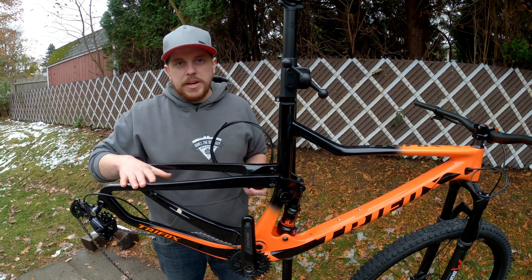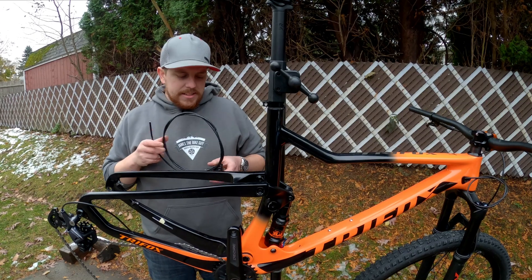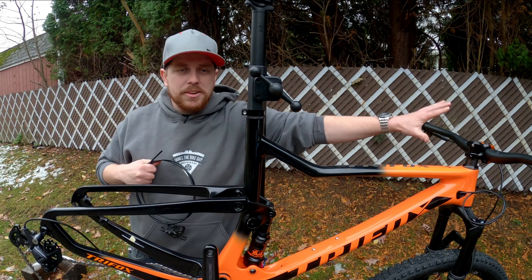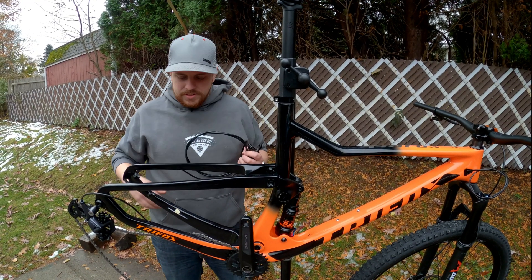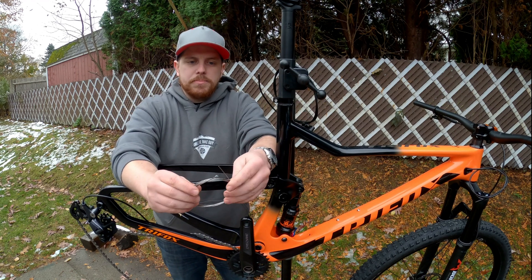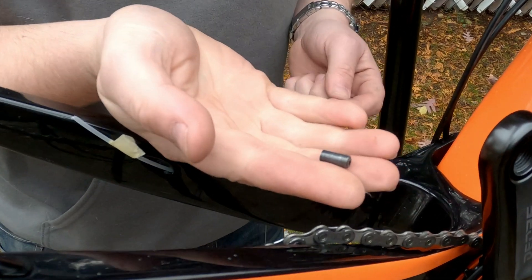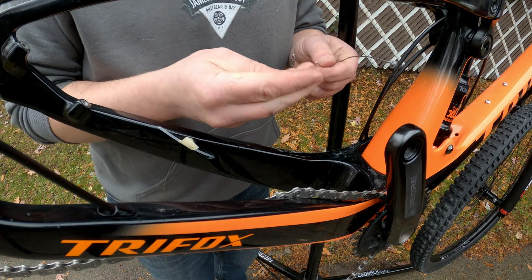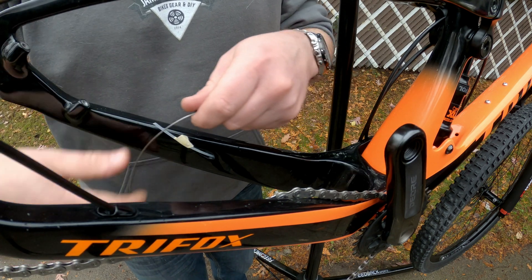To get a new hose installed on a frame, I find it almost always easiest to go from the back of the bike and send it up towards the front. That's because it's generally easier to cut and adjust the length of hose up at the handlebars rather than trying to get that set before you run the hose back. Because this frame has a plastic tube inside to help guide us through, we're going to start by taking apart our shift cable. With the shift cable unraveled, you can take your little ferrule — in a five millimeter size — and slide it right onto the shift cable.